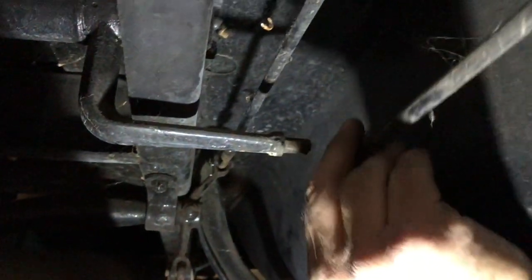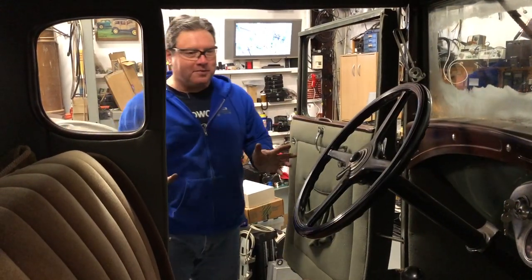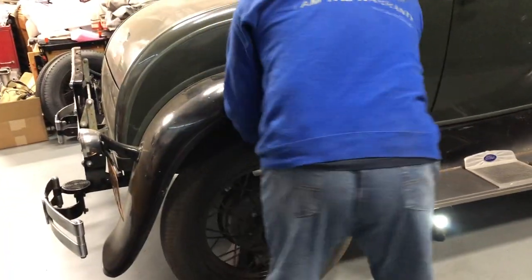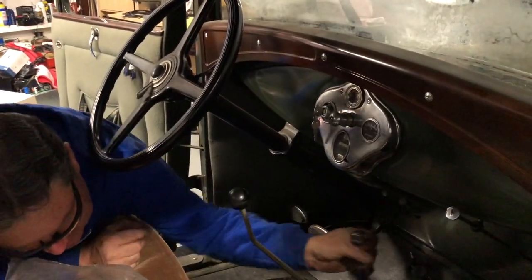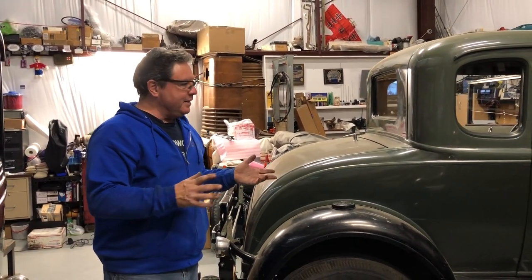Next thing we're going to do is the emergency brake or parking brake. Right now I've got these off and they're pretty loose, so I'm going to adjust these — same thing as the regular brakes. What I want is just a little bit of drag at the second notch and them locked on the third notch. So with the driving brakes fully adjusted, it's time to adjust the parking brake. I'll pull the parking brake lever a couple notches and check what kind of tightness I've got. Not much tightness — just a little drag at two clicks. Drag, drag, drag at three clicks. And locked. Brakes are done. Driving brakes adjusted. Parking brakes adjusted. Only thing left to do is drop this thing down on the ground, but it is late at night and starting to get cold, so bright and early tomorrow morning, this thing just might go for a drive.